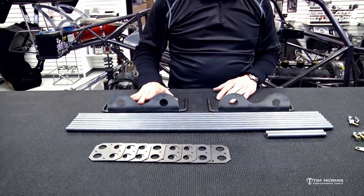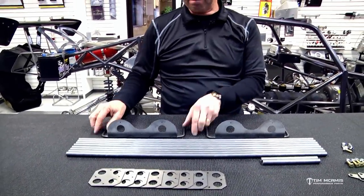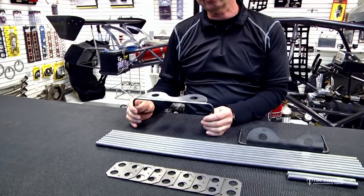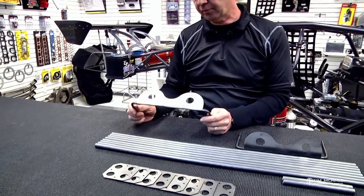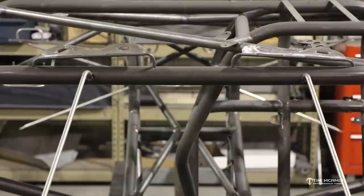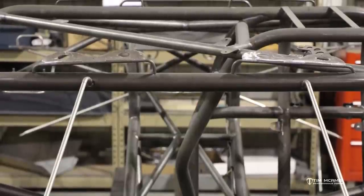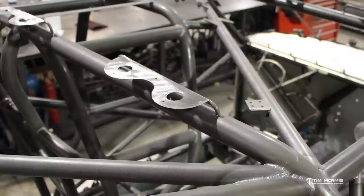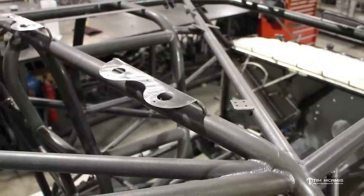These are what we would use at the front and the rear for roof mounts. This is going to be like two of these at the windshield tube and two of these at the main hoop, cut and fit sometimes around a little angle. This would go to the body, the legs would go to the chassis, and then this would be epoxied on after when you're ready to put the body on permanently.